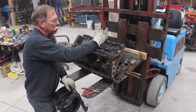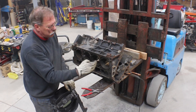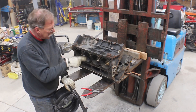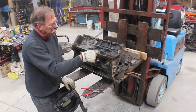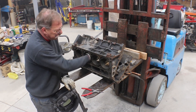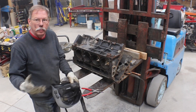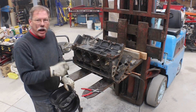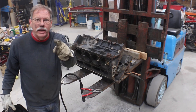How much can you take out? I decided to leave the main bearing journals on the second and third journals because they're lined up real close with the engine mounts, so that should add a little bit of strength to keep this thing from moving. I'm going to take out this cylinder and half of this one, and probably just stop there — leaving the webs near the motor mounts for strength. I can split this cylinder in half here, cut this one on an angle, and take out as much as I can while leaving strength around the engine mount, because I don't want the block flexing when we're bolting stuff to it.